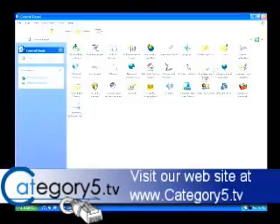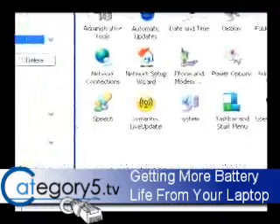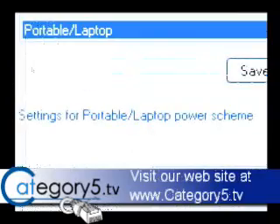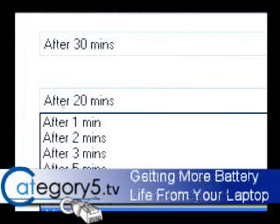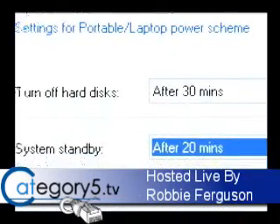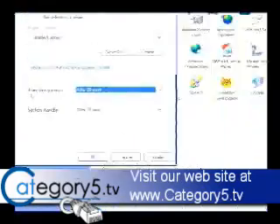In Windows XP, I'll hop over into the Control Panel. This is how it looks in XP — it's a little different in Vista, but look for Power Options. Your default settings may be set to something like 'Home or Office Desktop.' You can pull that down and change it to 'Portable and Laptop.' That will turn off your hard disks after 30 minutes and go into system standby — useful if you walk away and forget to turn it off. Turning off the hard disk basically spins down your drive, reducing power from that motorized peripheral.